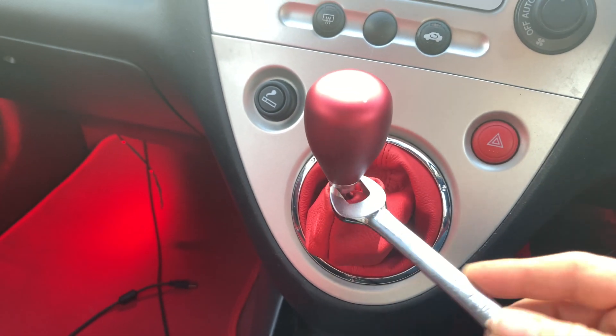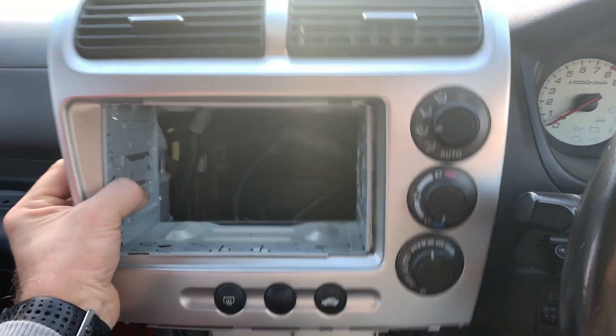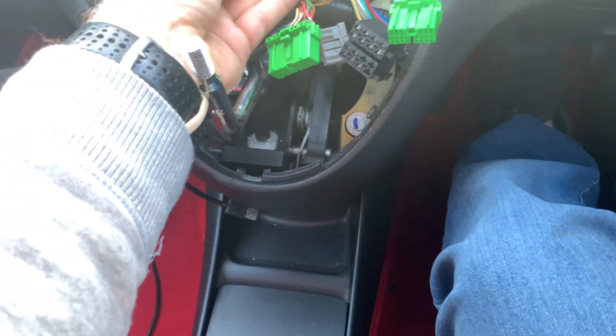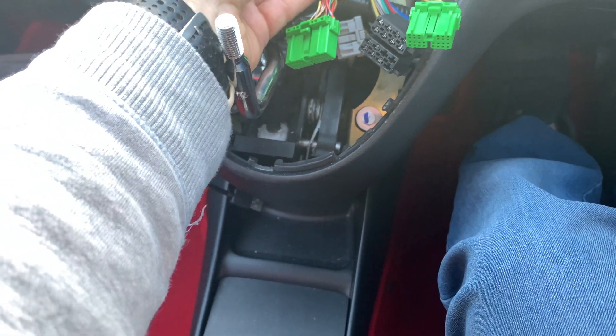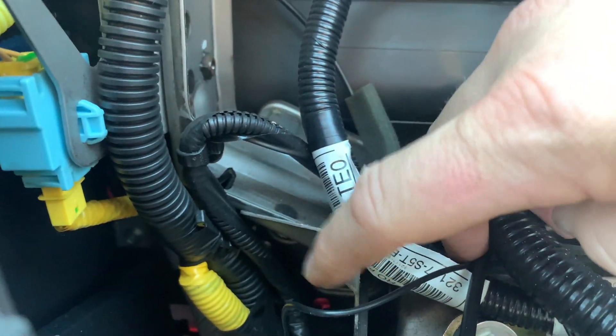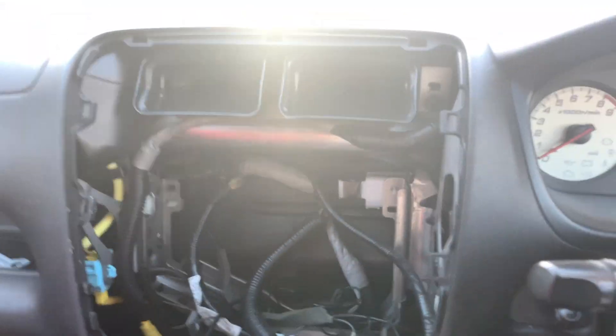This is much like my last video but in reverse when I fitted a gear knob, so this bit comes out dead easily. It's two Phillips screws for the bracket — I've done a video on this fitting the radio — and then you've got two 8mm bolts which go in there, and then you basically just lift it up and pull that out. Dead straightforward.